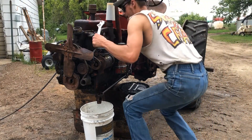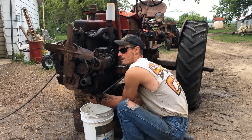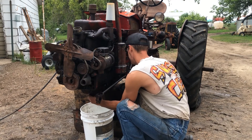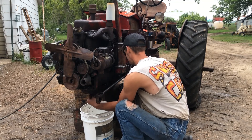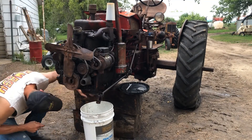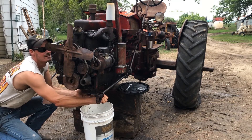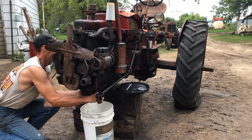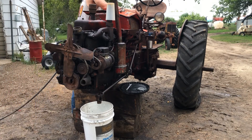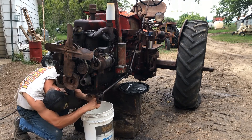Now that it's somewhat power washed off, it's still got a ways to go. It's got a crack in there so I know I'm getting water down in the oil pan. What we're gonna do is get this oil plug out — if I can get a bite onto it. Someone's rounded it at some point in its life. Let's try five-eighths — not good either.